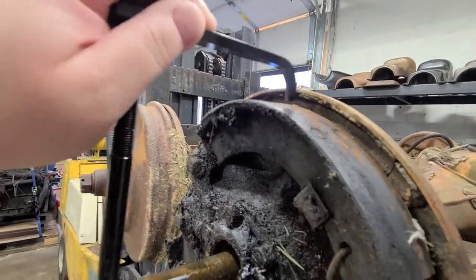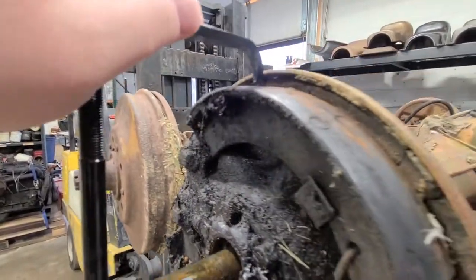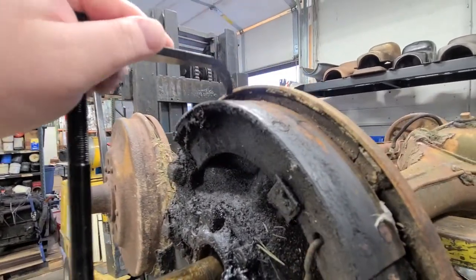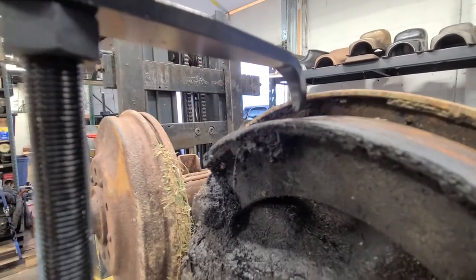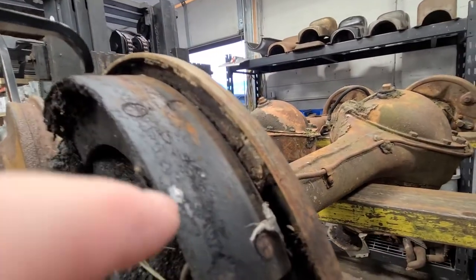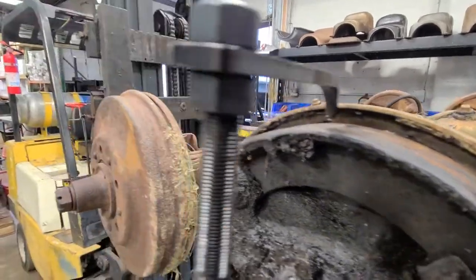The reason these cars don't have good brake feel is because the shoes don't get adjusted right. If the shoes are only hitting the brake drum at a certain angle — for example, if this side is hitting first and going up, and this side is hitting down and not hitting it the right way — it's not going to be good.